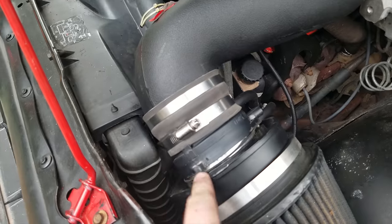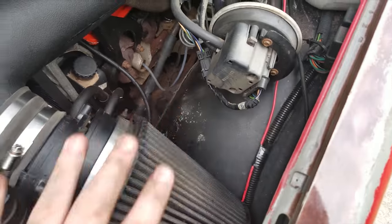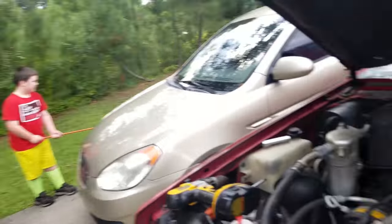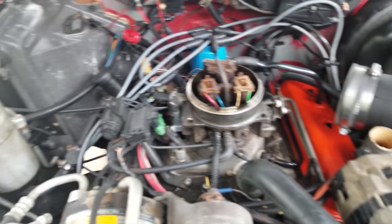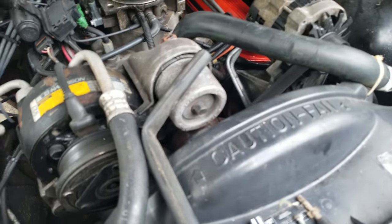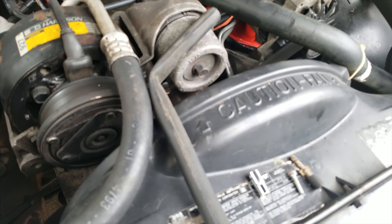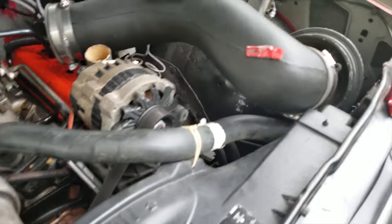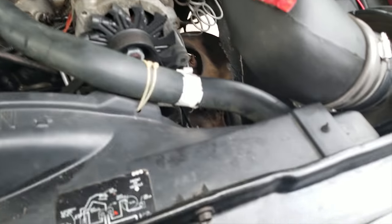I had to take off the big metal bracket thing because it was just too big, because it's designed for that huge Vortec V8 and I'm just out here running with a 4.3 V6. So it's not like a huge engine — it's a downgrade on the engine bay size. I actually got the hose backwards because that's how it's gonna have to work on my truck.